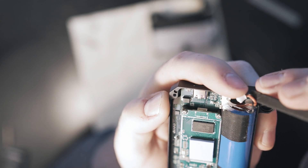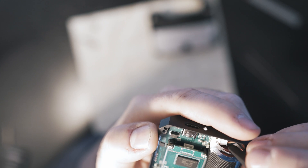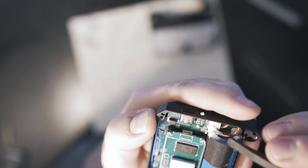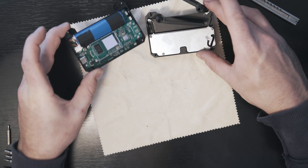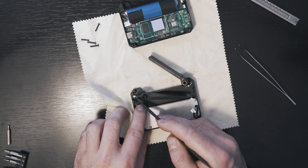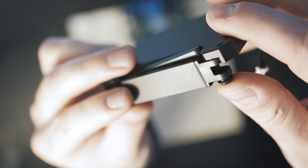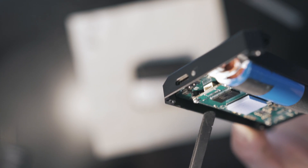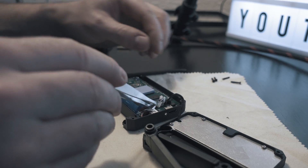It's time for the battery connector — should be easy. On the rear piece, place the RF cables into the holders and also put the antennas into their positions. Last to connect is the small cable which goes right here — gently grab and connect.